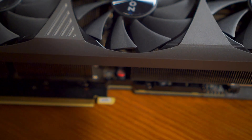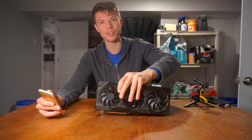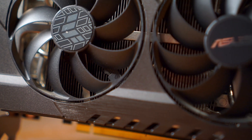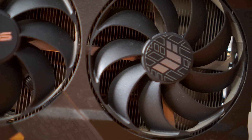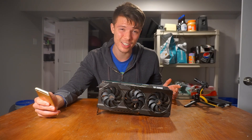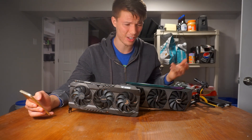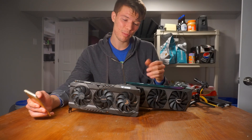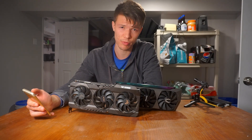This isn't trying to dig at Zotac — I'm sure most of the time they make really good cards, this one just didn't hit. The Asus card also has an extra HDMI port, and I'm not complaining about that. When deciding between board partner cards, performance isn't really what you're looking at — the difference from one partner model to the next is a couple of FPS at best. You're looking at quality-of-life features: how does the cooler perform, are the fans super loud, do you want more RGB, does your card need to be smaller, do you want a BIOS switch?